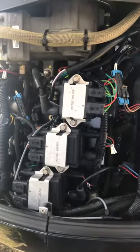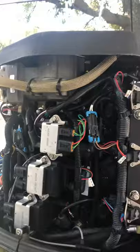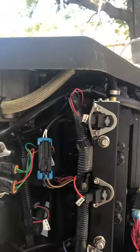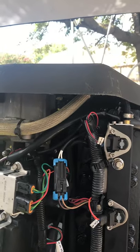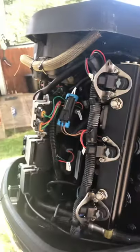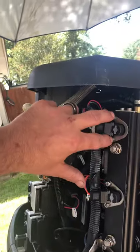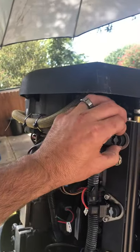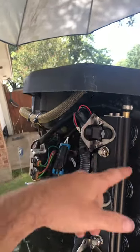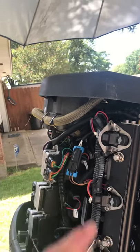For simple people out there like me just trying to do this stuff on your own — if you have some basic mechanical knowledge you can do a lot. These are the injectors right here and you can pull those out and clean them. It's fairly easy; it varies by boat model but this is a Mercury 150 OptiMax two-stroke. You just take these two little bolts out, grab some new O-rings, and they pull straight out.